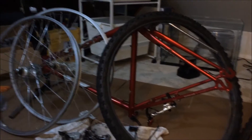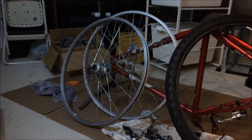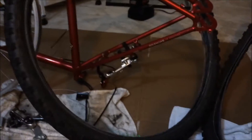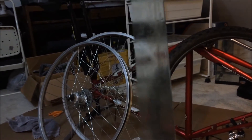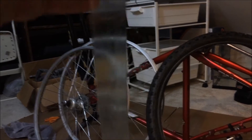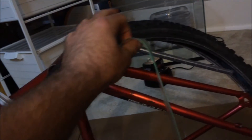I can get started on the wheels now. I got the tires off of my wheels — I know a really cool way to do it without any tire irons, probably look it up on YouTube. What I wanted to show you was these flat protectors. It's a strip of goopy plastic that's really hard to penetrate with a nail, and it lines the inside of the tire. You just roll it all the way around and it protects the inner tube.